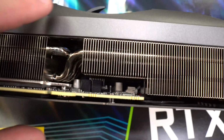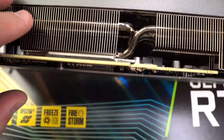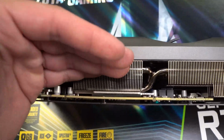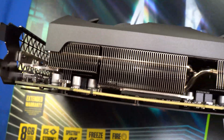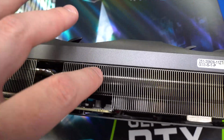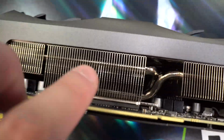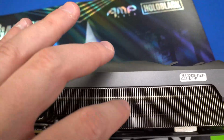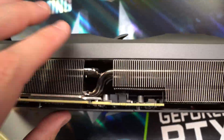Meaning, when this fan goes down to this heat pipe, or there's a couple heat pipes actually in there, but when these 2 fans go down, they hit the PCB. So it has hopefully cool air going in, and then it's trapped in there. And so the only way out is actually not through the IO plate. It looks like no air will actually come out of this. It will either be coming towards the motherboard or riser, or it will be going out the top. Yeah, actually looking through here, there are tons of heat pipes on this radiator right here compared to these 2. So good on Zotac for doing a design like that, because these heat pipes will cool down, like I said, substantially faster and way more efficiently than these 2 over here.